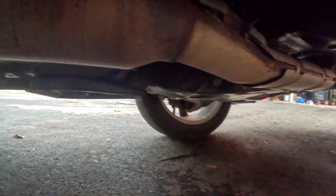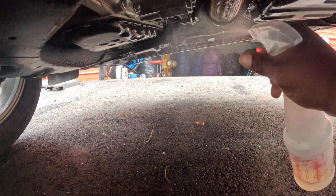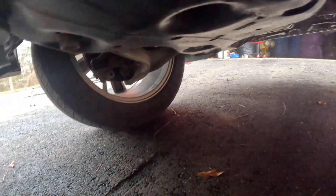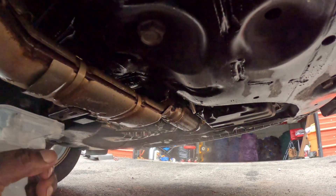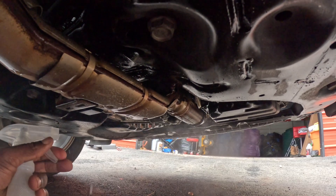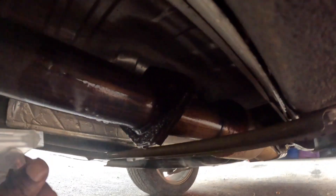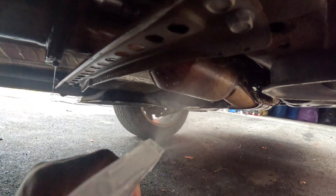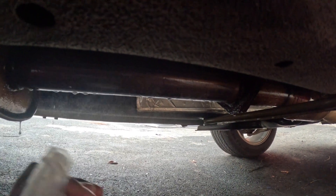All right, so this is the exhaust here going all the way to the front — just spray it down. Don't see no leaks. We're gonna go all the way up to the top. What you will see is bubbles starting to come up, pretty much like if you got a tire and you're trying to figure out where the hole is — same concept. All these couplings like this, spray it down — no exhaust leak there. Sometimes it might just be a little hole in the exhaust going to the tailpipe.